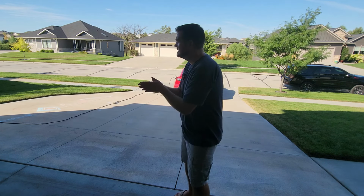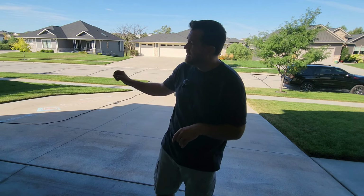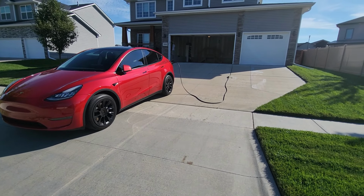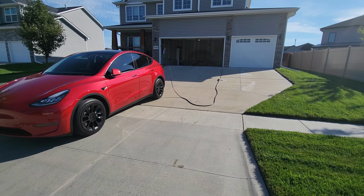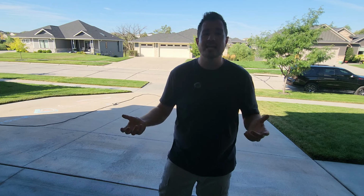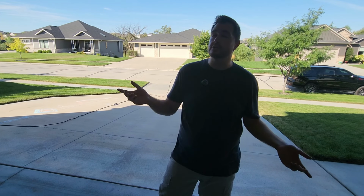Additionally, this cord extends the right end of your mobile connector. You can buy heavy-duty extension cords that have the specific 110 volt end, but this one extends the correct end. Whether you're dealing with the 5-15 plug at your mom's house, a 6-20 circuit at your dad's house, or the 14-50 maybe someone else has installed at one of your friend's houses, this single extension cable can extend any of those outlets for you without needing four different cords.